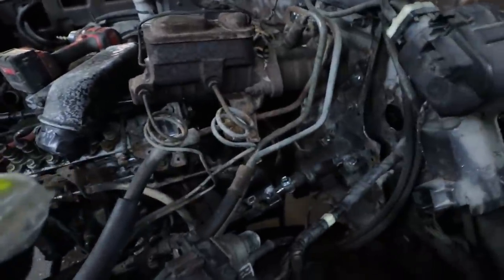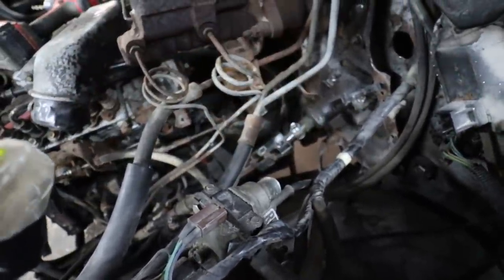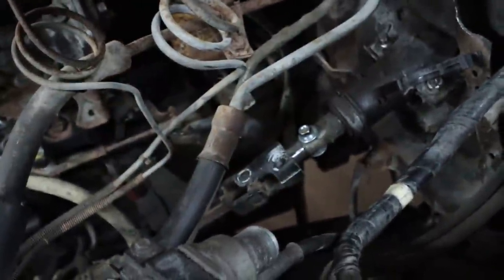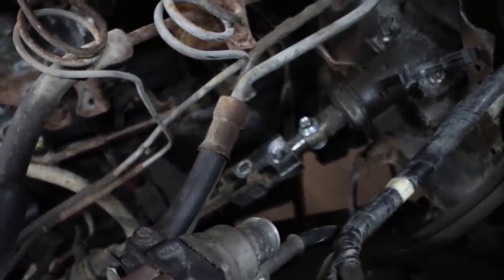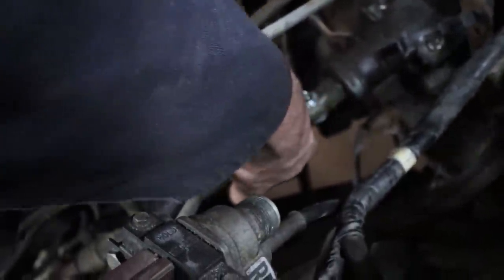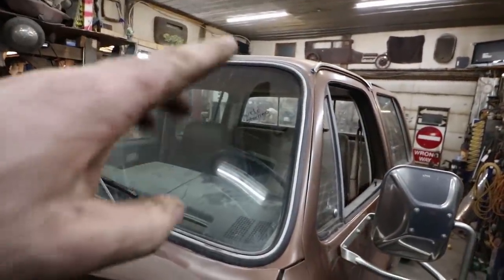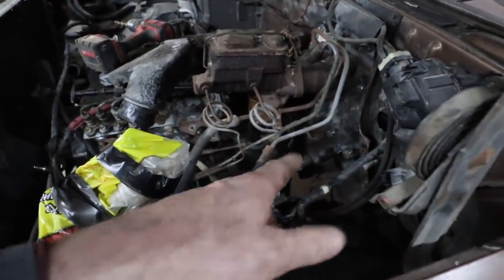I made a slip-in joint that goes inside the steering. So the actual slip shaft from the original GM one is what fits inside of the Dodge shaft. So I made a slug that goes into here. It's just bolted to sandwich it so this thing can't come apart. I am going to weld this around. I've just made a note on the windshield that when we pull the body off, we're going to weld that. And then it just bolts up and she's golden.